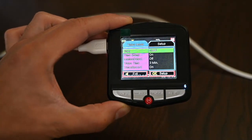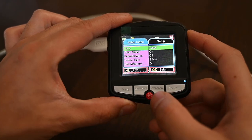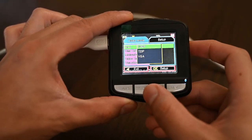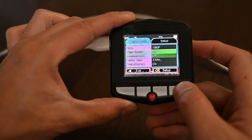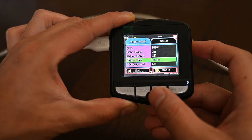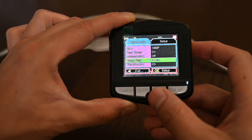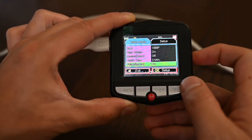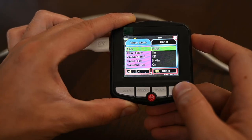In the video mode menu, we have a whole bunch of options. First, we have the size — you can toggle up and down between resolutions. There are three resolutions; I'll keep mine at the highest. There's a timestamp option which gives you the ability to have a watermark date on the video. There's motion detection, which we'll go through later. There's a video time setting — that's how long each video clip will be before creating a new file, so at three minutes it creates a new file. We also have the voice recorder option, which you can turn on or off depending on whether you want to record sound inside or outside the car.